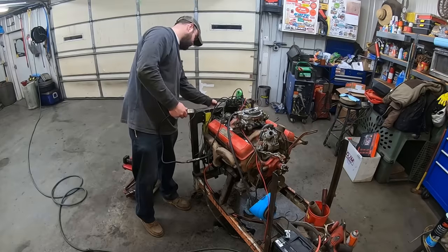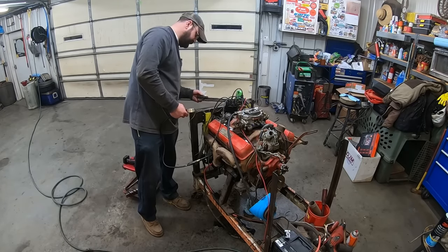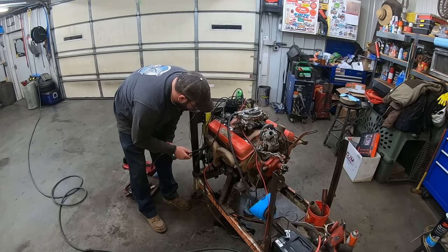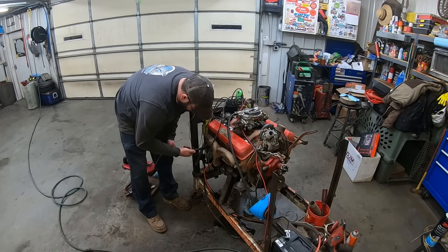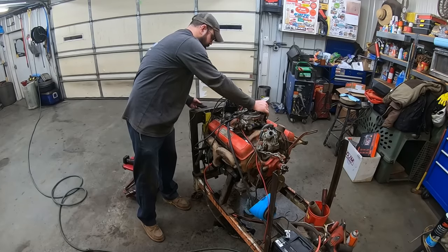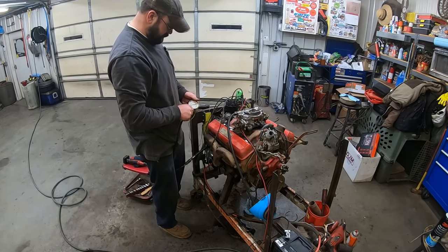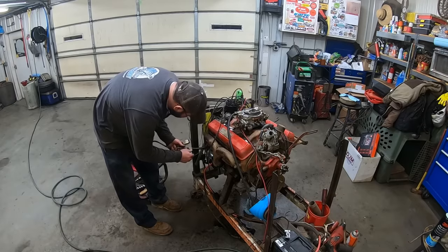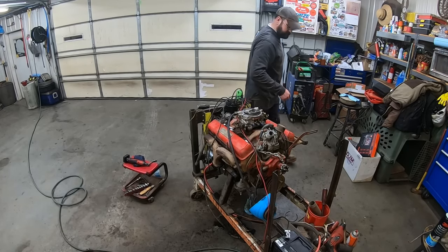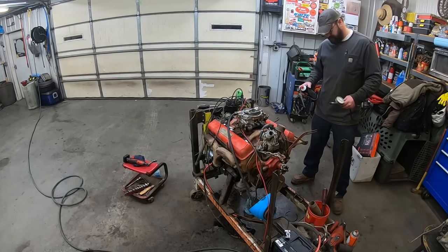20. There's an 85. I think that's what we're hearing fire, that 85. 90. Another 50. Oh man, that is disappointing. We're gonna play the pull the plugs out a million times and squirt oil in the cylinders until we get it to pop. I think this engine deserves a set of rings.